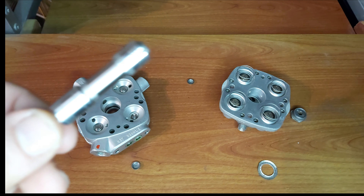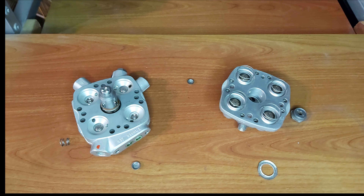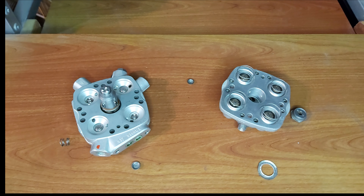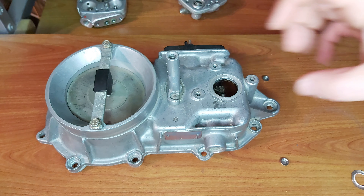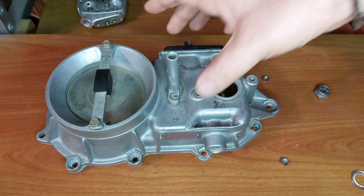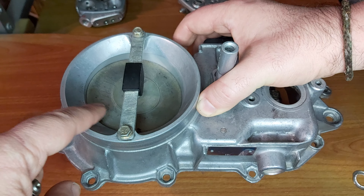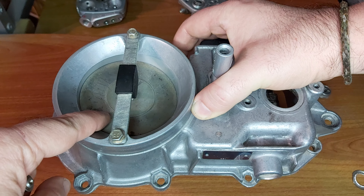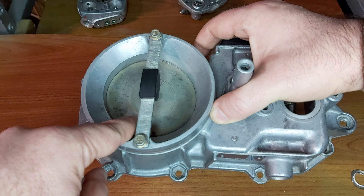The thing that moves the plunger is the sensor plate. As the sensor plate moves downwards, this piston goes up. By turning the mixture screw counterclockwise, you make the gap here less — so the more you turn the screw counterclockwise, the more this plate falls like this.